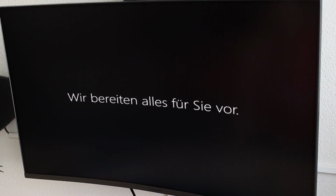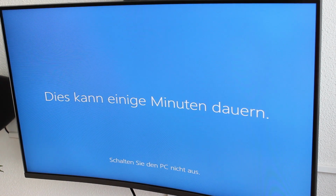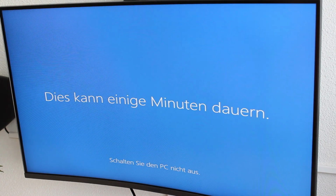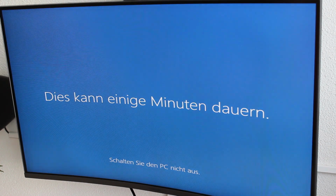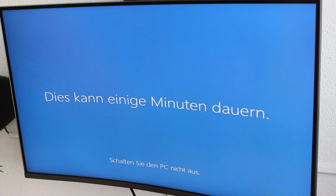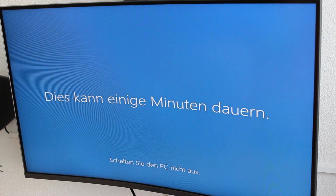And then your computer will begin to start up and initialize some of the drivers. Most of the drivers will be ready once you get the Windows screen, except for the graphics card. Very often you will have to install the graphics card driver manually or by using the Windows Device Manager, where you can use Windows Update to install your graphics card drivers. And I usually go this route. Maybe you won't get the most recent driver revision, but it is a good starting point if you just want to install all your basic software and then deal with some more revised drivers.